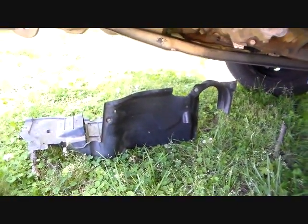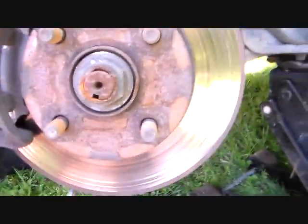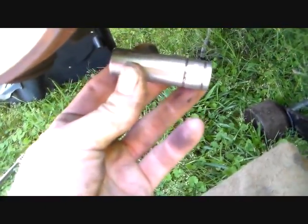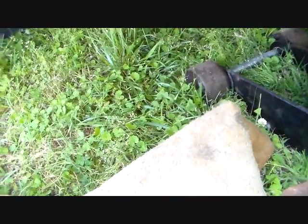Okay, since we got that splash shield off, the next order of business is we're gonna need to get under, and there's a pinch bolt. It's called a pinch bolt right under this. Here it is. It holds this bottom ball joint in. It's a 14 millimeter on each end. The head of the bolt is over here where I have my wrench put on, and you just use the socket and undo the other side of it and just take it out, and that's what separates your lower ball joint